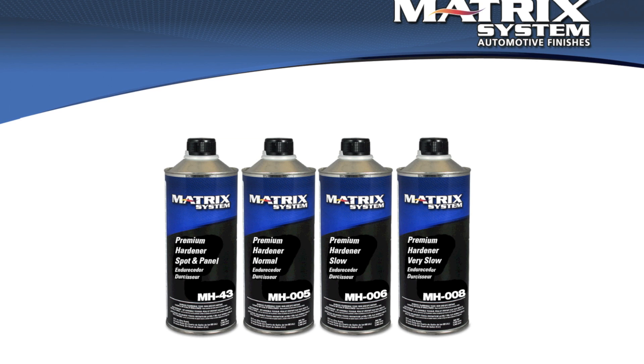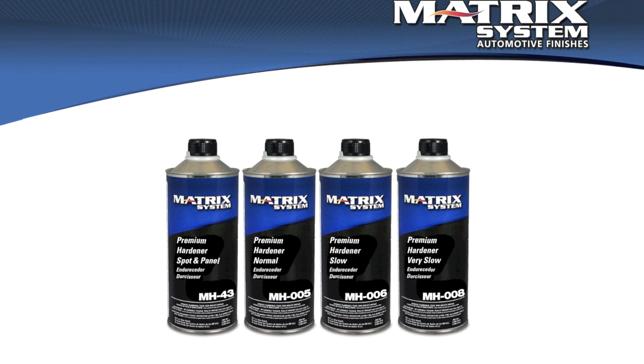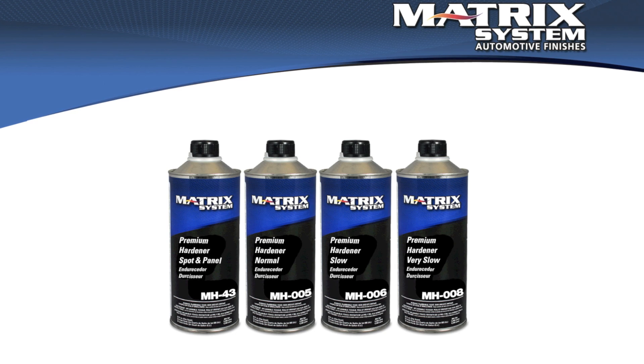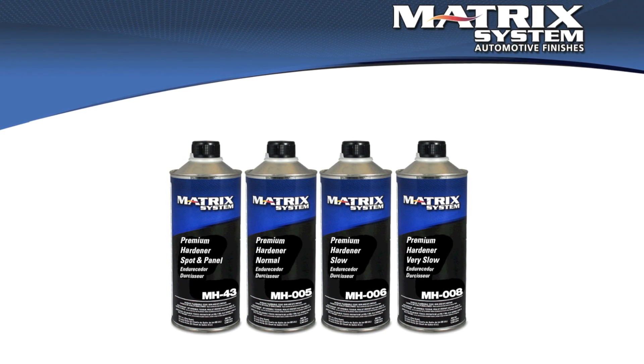The speed and leveling of the clear coats is the same kind of issue. If it's too fast, we're likely to get more orange peel, maybe solvent popping, die-back, stuff like that associated with excessive film build. If it's too slow, we're going to waste time, have extended dry times, running, and difficult handling.